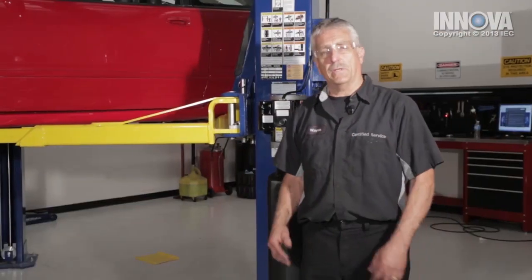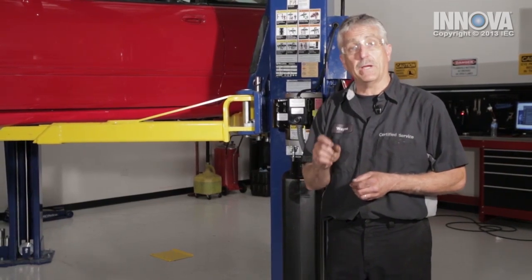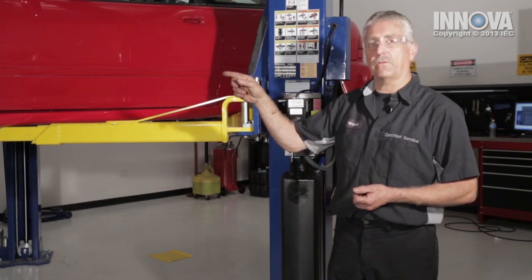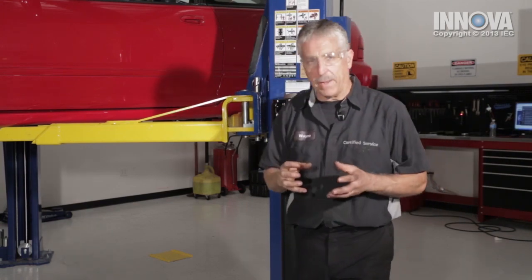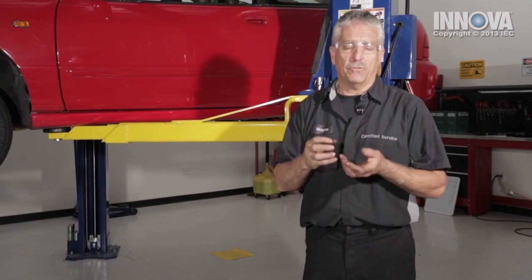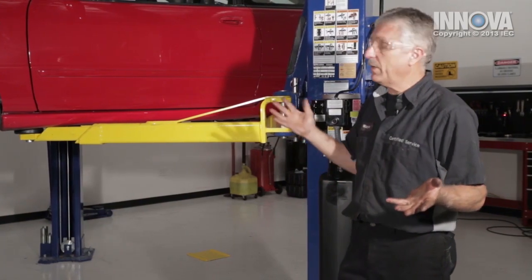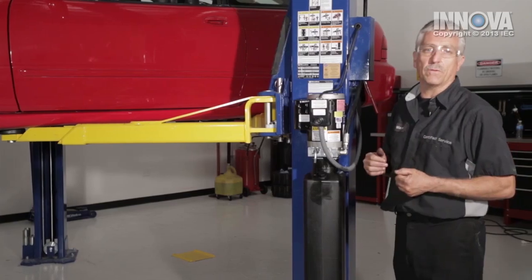Now that we've put the brakes back together, first thing we did is inspect the brake pad thickness. The brake pads were good, so the brakes on this car are good to go. I like to use Loctite on the bolts in the front when you put the calipers back on because it's a safety item — you want to ensure it's not going to come off. A little bit of Loctite is a good thing. Well, everything is good. We've got the wheels torqued down. Let's go for a road test and return this car to the customer.